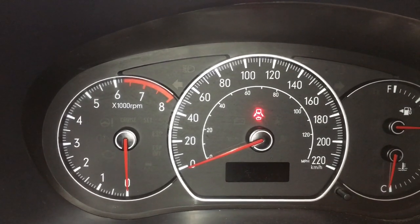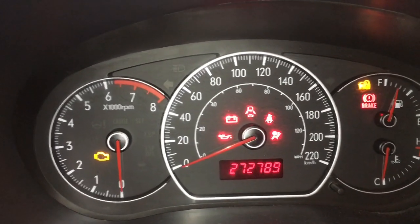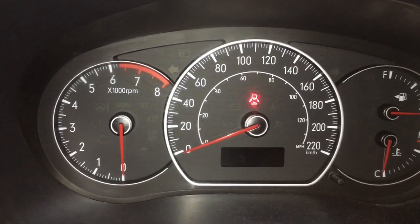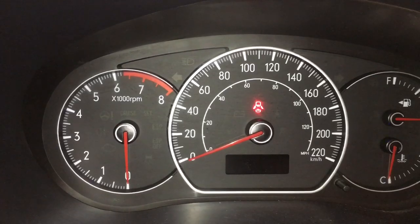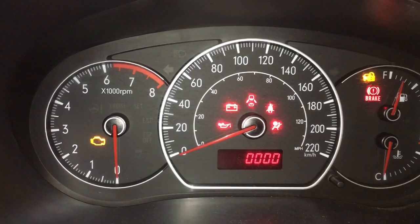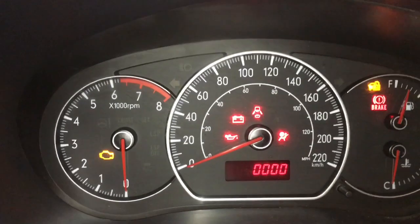You've got to be pretty quick about it. So: ignition switch on, headlights one, two, three, four, and door switch one, two, three, four. Let's see if it actually reset the codes. I expected zero to come up after the reset, but let's do a read procedure again — ignition switch to on, three times on the headlight switch, three times on the door switch. And we have zeros. So yeah, I expected those zeros to come up after the reset procedure, but you'll have to actually do the read procedure again to confirm it's all zeros. It works as advertised.